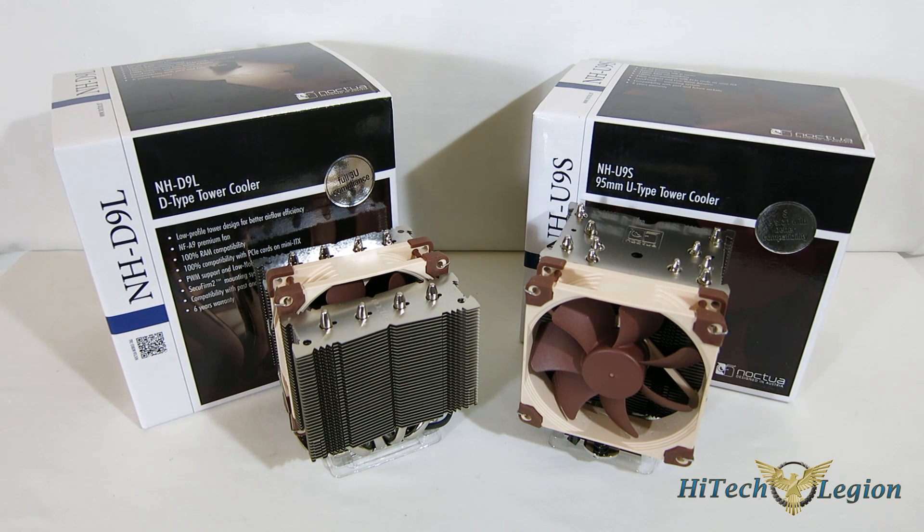With small form factors, you need a smaller cooler. Rack mount coolers have been made for quite some time and have to be a very, very short stature. Now we're going to take a look at a couple of pieces from Noctua — the NH-D9L and NH-U9S — which are fully compliant with 3U and 4U server rack mount applications, but also have some significant advantages in small form factor and HTPC computing.